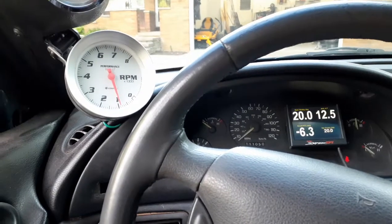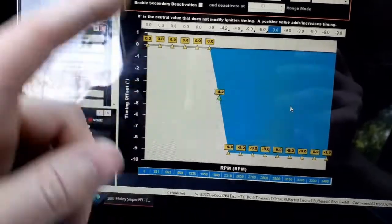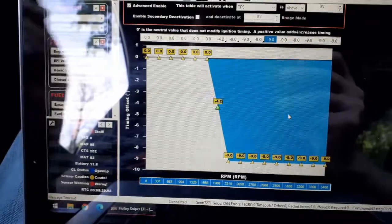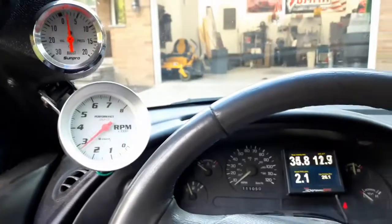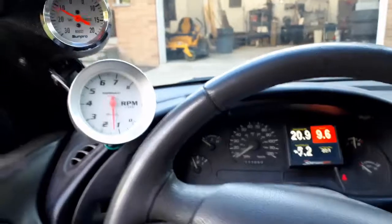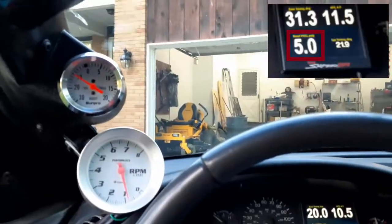Just real quick — this is how the table turned out. We moved it to nine degrees at 2300 RPM. Down there it was at like 28 but we would have never gotten up that high since we can't hit that high of RPM launching in the driveway without it spinning. This is kind of a proof of concept to see what it does. There's four pounds right there pulling the brake as hard as I can — so proof of concept, it works.